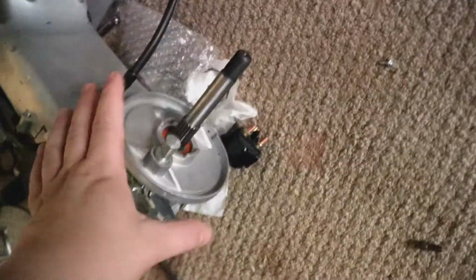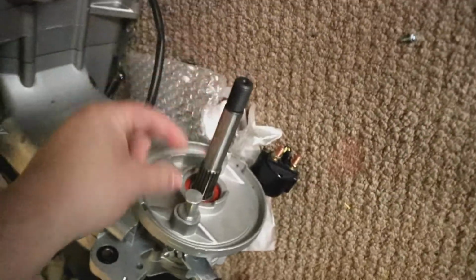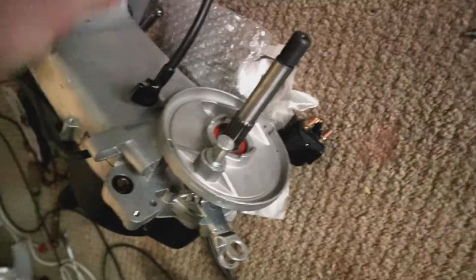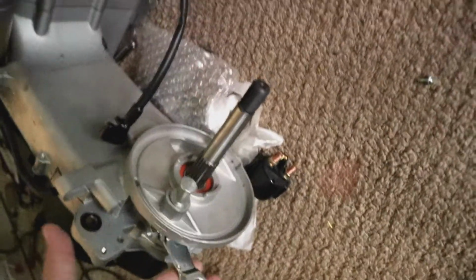See, this right here is the brake assembly. The brakes would sit on either side. And when you pull the brakes, it would actually pull the calipers out so you could actually stop your brake hub. This whole assembly gets replaced with a shorter spline where that is here and none of the center shaft is in the way. So realistically, that's not a hard job. It's something you have to do anyway. If you get a new GY6, you have to convert it to short axle for the bikes, whatever.